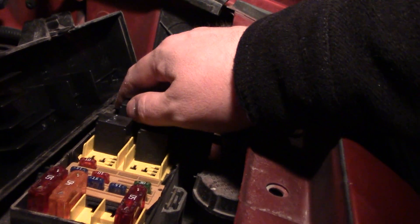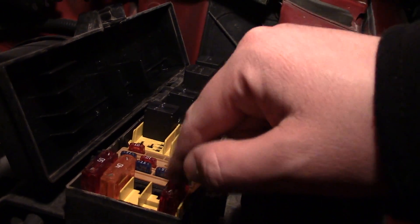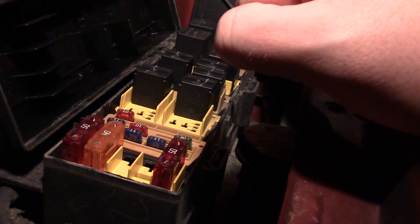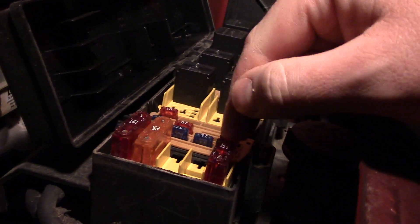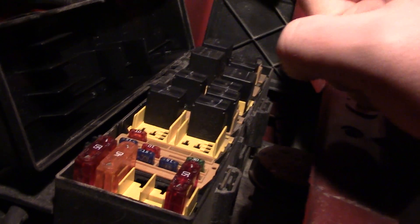But these are all components that can go bad, and that's where both of them are. So if something in your car that requires electricity isn't functioning, you can go ahead and check the fuses on both the dash by the door or under the hood of the car. Then using that fuse puller, just pop each one out and inspect it.